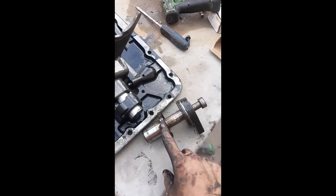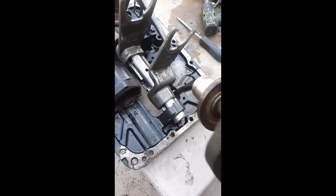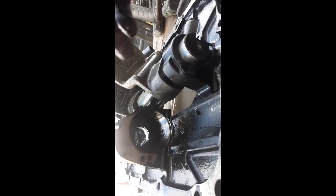This kit comes with a new piston and a new o-ring — it's about 20 bucks. This is very simple to change. All you have is a snap ring right in here, and that pops out so this whole thing will slide out. The number one thing to take note of is inside the cylinder — you want to make sure you get that cleaned up. If you want to buy a whole new top plate with a new fork assembly you could, but at the very least get this cleaned up in here. It's nasty and it's just going to eat up your new seal again if you don't.